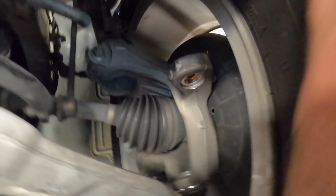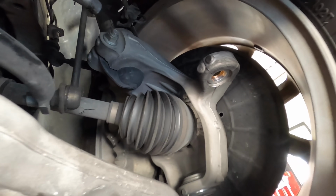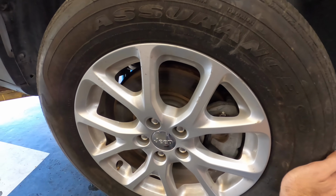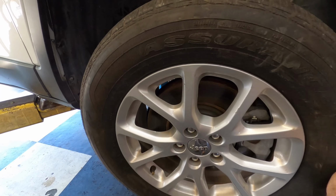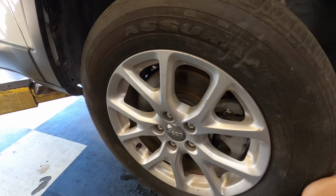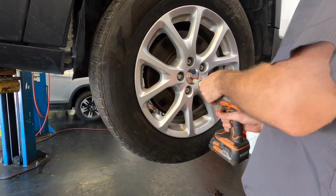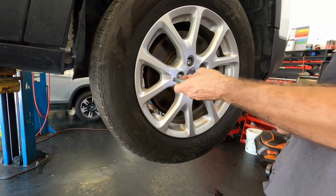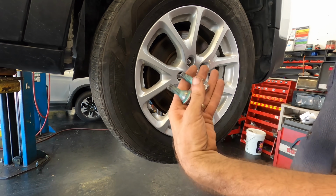It appears that some critical steering components are not present. Wow, look at that inner tie rod. Nice. That's broken. Alright, let's pull the wheel off. Me thinks it has some loose steering parts. Well, that's the problem. They built it out of Fiat parts. Look at that.